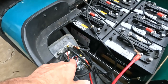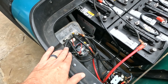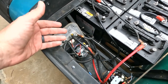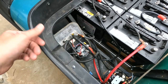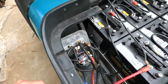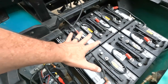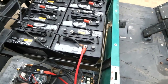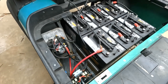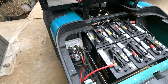I need to replace the controller. This is a 300 amp Curtis remanufactured controller — come to find out it's just too weak, it's shutting down on me. When it's cold it won't hardly climb a hill; once it warms up I get my power back. But then if I keep using it, keep putting it under a load, it'll go into thermal shutdown and just die until it cools off. So I'm pretty sure it's the speed controller — process of elimination, it pretty much has to be. The motor is remanufactured, the batteries are new and test out good, the forward control switch is new, I have two gauge welding cable — so all my cables are new. It's showing all the classic symptoms.